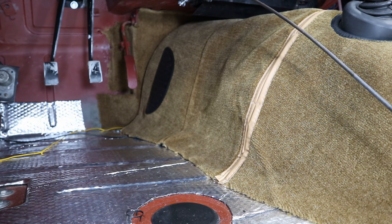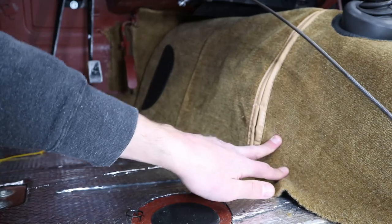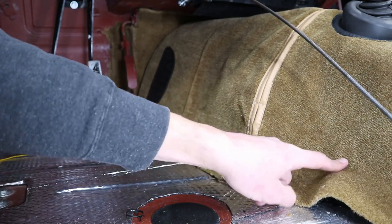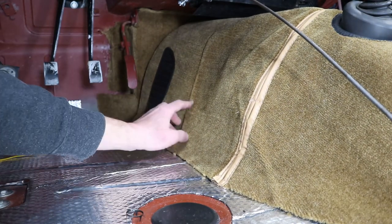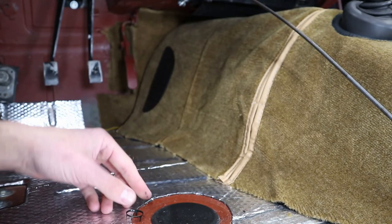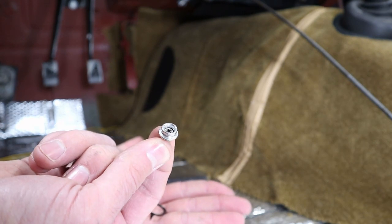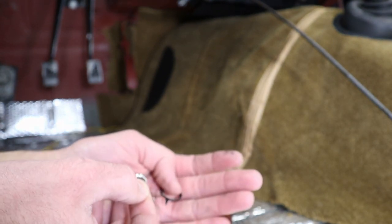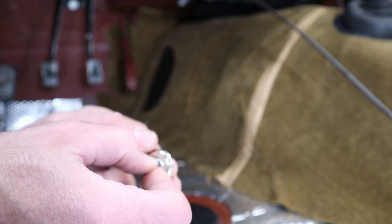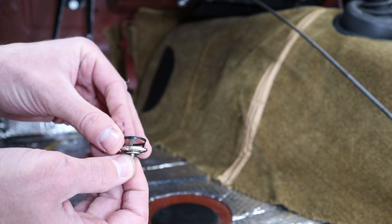We're looking at our snap locations here. We don't have any snaps on our gearbox cover yet — it's a new cover — so we're going to have to figure out where those go. It looks like the car originally would have had three snaps on each side on this piece of carpet: one pretty far up to the front, one kind of in the middle, and then one underneath the shifter from the pictures we've seen. This is the little assembly right here — it's three pieces. You have a male part of the snap that goes into the gearbox cover, then you have this little ring that actually snaps onto the snap, and then this little metal ring which goes through the carpet.